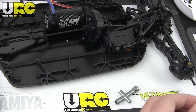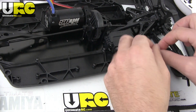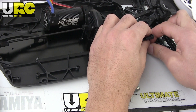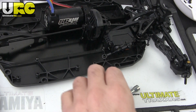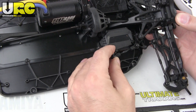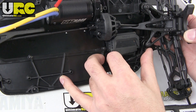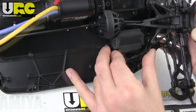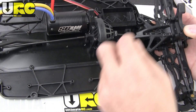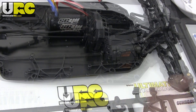The instructions say to use a 25-millimeter length on the drag link, but inside-edge measurement looks more like 20 to 20.5 millimeters — that's a better ballpark. It'll still need some adjustment but it brings everything in closer. At full steering lock this link just barely touches one wing of the servo itself, though the motion is actually being stopped by the left-side knuckle when turning left. Hopefully that won't be a problem.